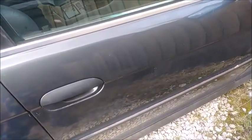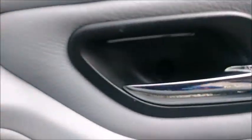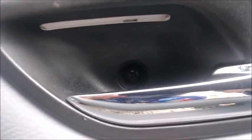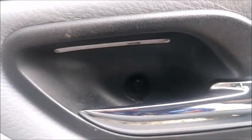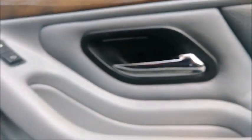Replacing the mirror gives me an excuse to open up the door panel anyway to check on that airbag, since we do have an airbag code. Using my pick, I got the plastic piece out from behind the door handle, which uncovers a Phillips screw. We'll take that out and then use our plastic pry tool to start popping the door panel off.